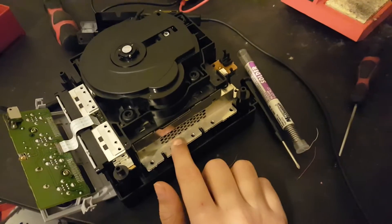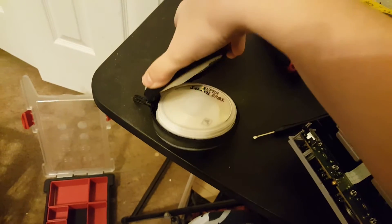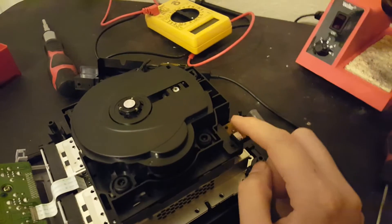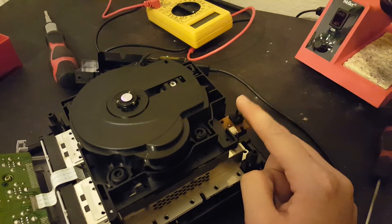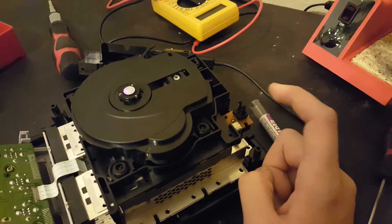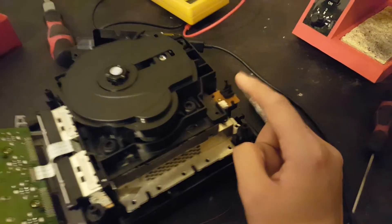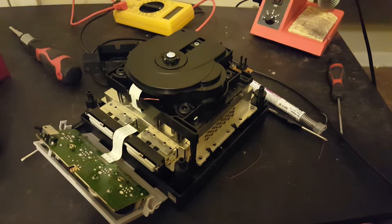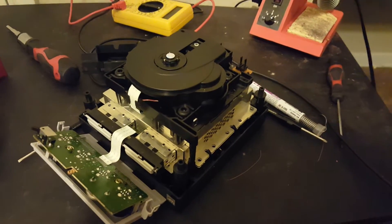The next thing you're going to need to do is plug in your AV cables. Once you get that blink pattern showing, plug in your AV cables to your TV and pop in a burned copy of a game and turn it on. It's important that you hold these two switches backwards when you do that — this is the lid switch, and it tells your GameCube that the lid's closed so it looks for a disc. If you're not holding these down, it'll think the lid is open and not read anything. Pop in a burned game and if it reads it, fantastic — pop in another one and make sure it reads all of them.